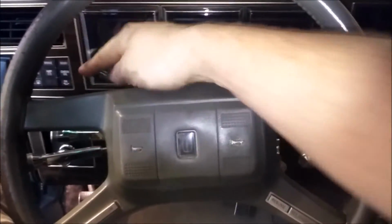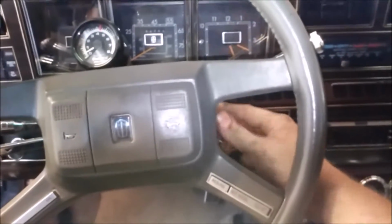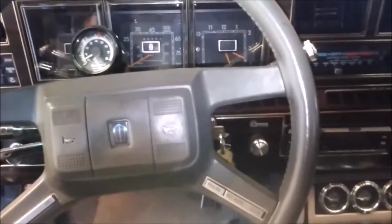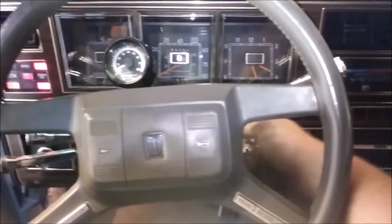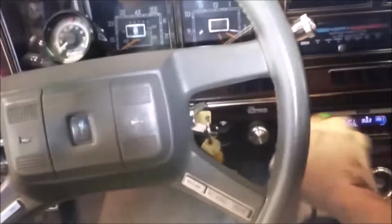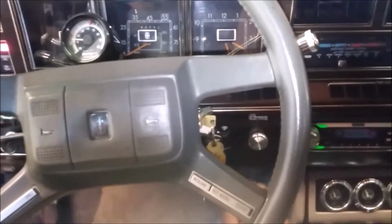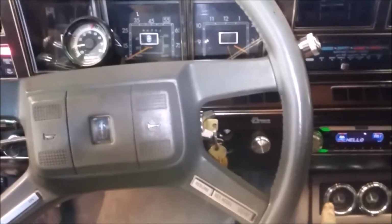All right, we'll try and get a view from the operational side of it. The light that I just fixed is right there, and the oil pressure gauge is right there. So, all right, engine off, everything's at 0. Key on. I have the oil pressure idiot light and music apparently. So 0 oil pressure. So we have the gauge comes up, and the idiot light over there went away.